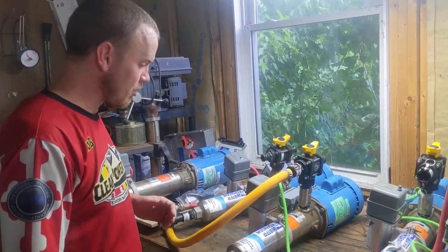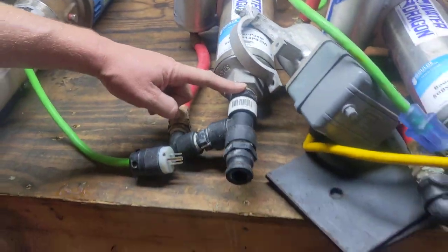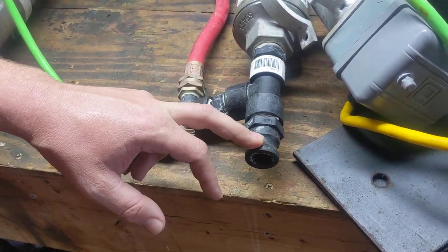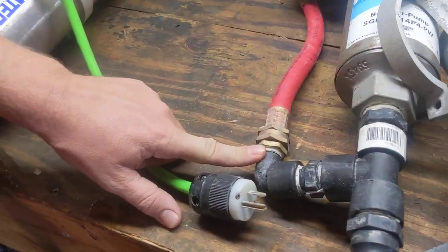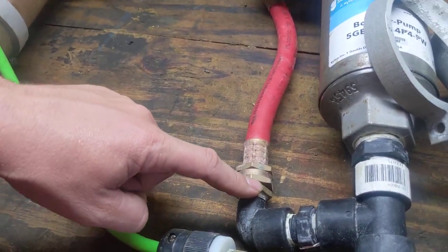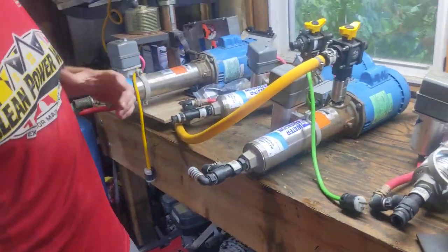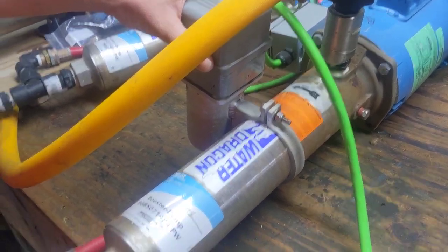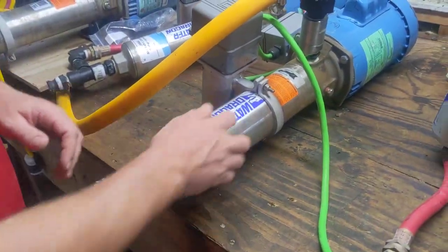You can see these are all the same style pro switch with a shorter jumper hose. In this configuration, you have a one-inch outlet coming down to three-quarter-inch male, with a three-quarter-inch tee. These are all cam locks, so you can take them off and on each rig pretty quickly. You've got three-quarter male out, and then a garden hose adapter here to go from male pipe thread to garden hose thread. To service one of these, you loosen this, take the pro switch off, and remove the garden hose connection. These are reverse-threaded — left is tight, right is loose.